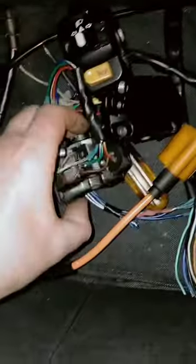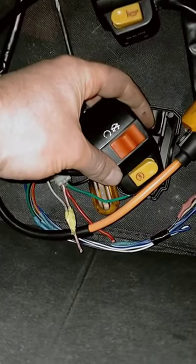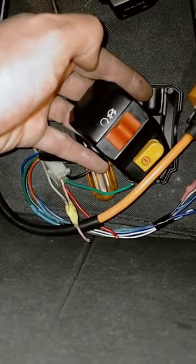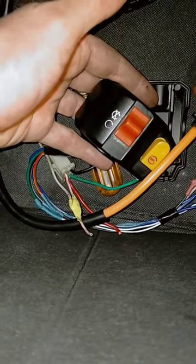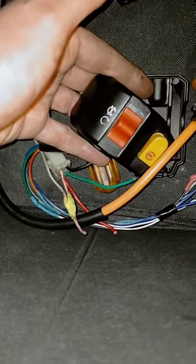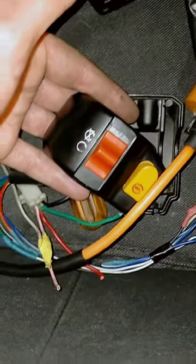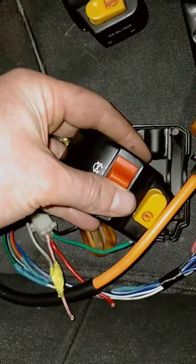This is your kill switch. That's a little complicated to understand, but basically it works the same as your key. Off is power disconnected and kill switch enabled. On is simply kill switch disabled and power connected to the entire scooter. That's black and pink connected together, and that is green and red connected together. Don't quote me on the colours of your wiring — you have to look at how it works. They're different on every scooter because different countries have different wiring colours, but generally the electricity is going to work the same everywhere.